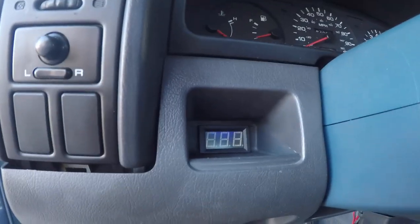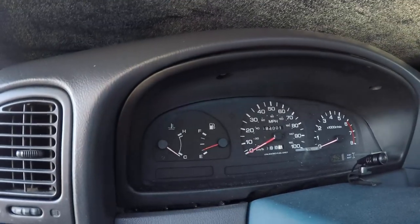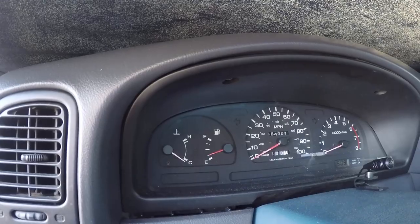I've got a voltmeter gauge up here because there's nothing on the dash besides the warning light for the battery — and by that point it's usually too late. I had an issue going to work a few years back with the stock alternator, because it's only 60 amps. I've got a cheap subwoofer and amp back here for speakers, and it ended up pulling too much. Trucked out on me on the way to work, so ever since then I've basically run one of those voltmeters. On the 95 dash it's this little spot.